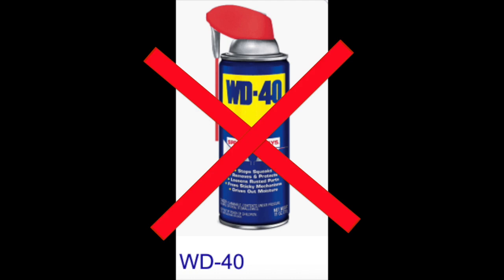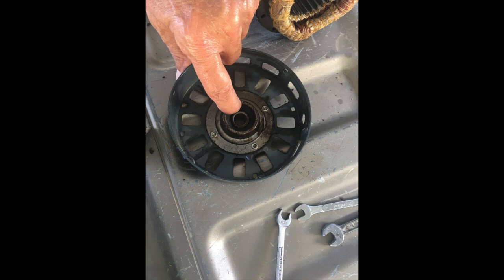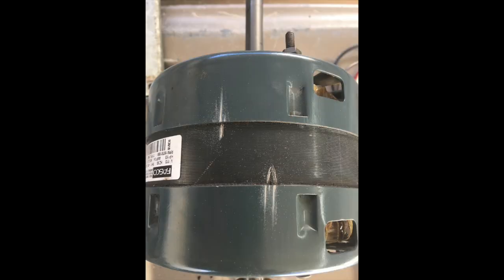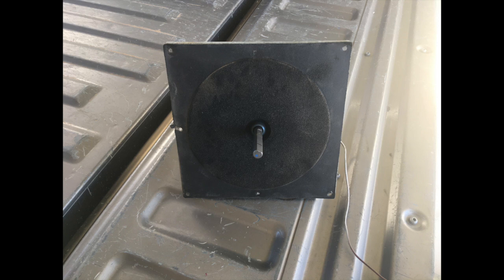After removing the other side of the motor housing and re-oiling that bearing, allow the two halves of the housing to sit upright to make sure no oil drips out. If it does, you know you have put in too much oil — you can then gently press on the Permawick material with your fingers and try to force some of the oil out. If no oil drips out after 10 minutes or so, put the motor back together using the file marks you previously made to correctly align it, reinstall the bolts and nuts, and then reinstall it back onto the plate. The rubber mat should stick back on. If it doesn't, you could use a bit of rubber cement or something similar on the sticky side of it to help in reattaching it.